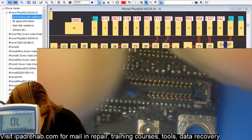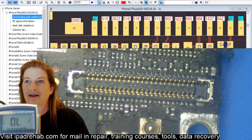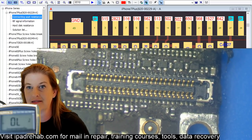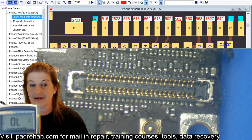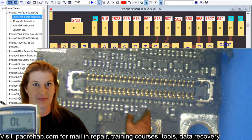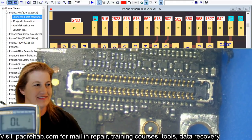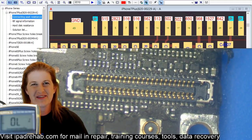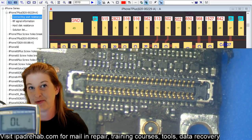We still have nine remaining pins in this connector on the bottom side. Let's scroll down in ZXW and measure those last nine. Hopefully something comes up as different. If not, we'd need to look at where else image is handled — maybe the GPU. But a lot of image lines end up at this connector: lines that control whether you can detect an LCD, reset the LCD, sync the LCD. Any short to ground or open line on any of those data lines can kill your image.